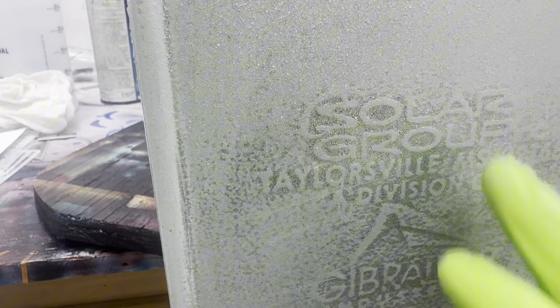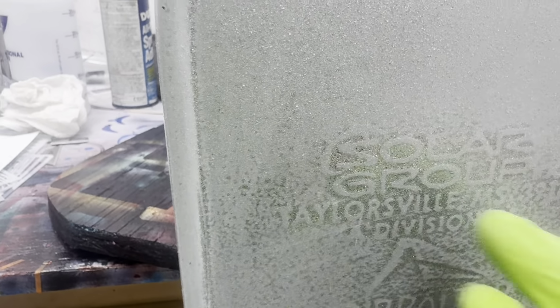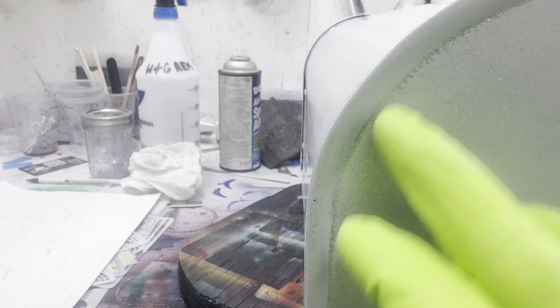It's shiny, so I'll hit this with a maroon scuff pad. Same thing with these little corners in here that were hard to get to. And you just keep sanding this till it's smooth, but you don't want to hit the flake. If you start hitting the flake, then you have to stop, clean it, put another couple coats of clear, and sand again.